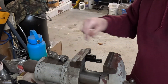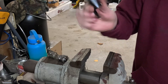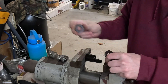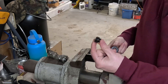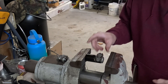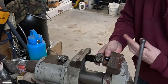Let's jump over to the vice. This tool is worth its weight in gold — it's magnetic, though I wish the magnet was a little bit stronger. This unit goes onto your vice, you get two thick washers for getting your new arm centered, and then you get this device used to push the old bearings out and install the new ones. First things first, we'll open this up and use the big cup here — it'll sit down on the cap of our old bearing.